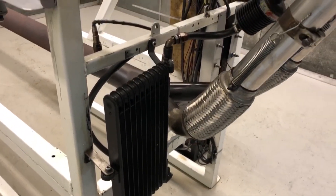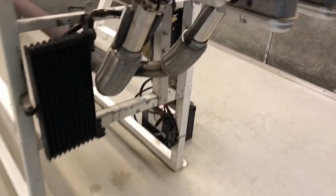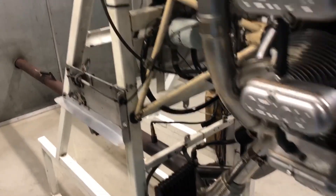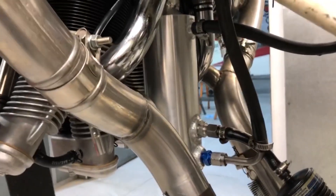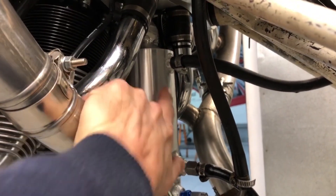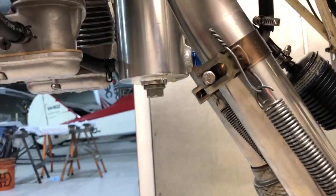I've got a large motorcycle oil cooler down here which is plumbed through the scavenge pump — the electric scavenge pump. They've got flexible exhaust couplings there so I can easily attach the four-inch pipe to the rear where there's a large silencer outside. What's interesting on this particular engine — for a while we've been running this twin-port mini sump. You can see it's beautifully made, all machined and welded flush, and it's got two TIG-welded ports.